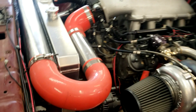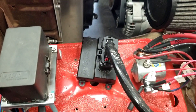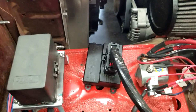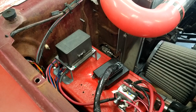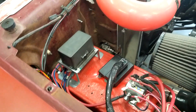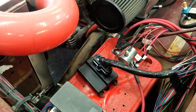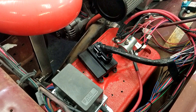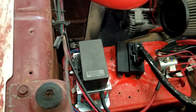So that is sweet. The micro is at its limits — I'm sure that's the problem. If I don't try to data log and I don't try to do auto tune, it won't drop cylinders after the end of a run. If I do that, I think it's just too much for the ECU and it starts breaking up, spitting, coughing, missing, and then it'll just drop a bank of cylinders and you've got to power cycle it to come back up. So the micro is at its limit for this project, which is odd because Sloppy got his to work, but he's got more skills than I do. I sold the MS3 because we needed the money, so now I don't know what I'm going to do. I was gambling this would work well and it really didn't.